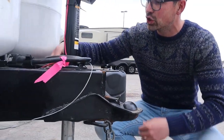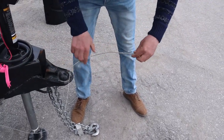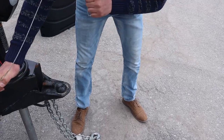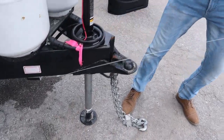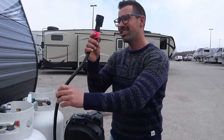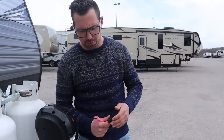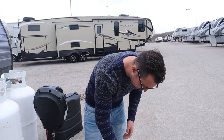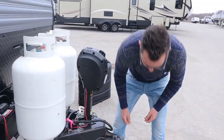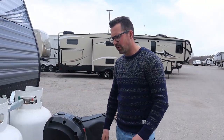The chains crisscross underneath the hitch — just in case the trailer becomes unhooked, it's going to cradle in these chains. Then you have your breakaway cable, which is this guy right here. I like to run it through the pin and it hooks up to the truck with a separate link. Basically, if the trailer becomes detached, it pulls out of the breakaway switch and locks the brakes on the trailer so it doesn't follow you down the road. Then you've got your seven-way connection for your lights.